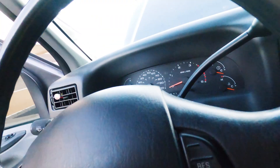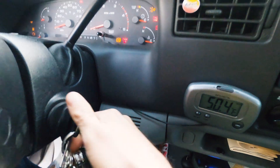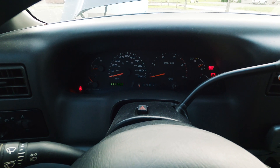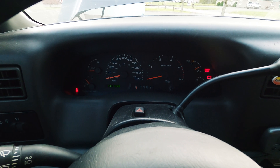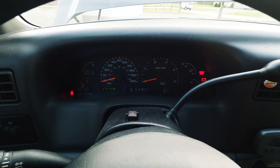So here's how you do it. Get in the truck — or SUV or whatever, we just have a truck for this one. Put the key in, and what we're going to do is turn the key to the ON position. You have to let it be on for about 30 seconds, and you'll be able to hear it shut off. There — you can hear that little click.